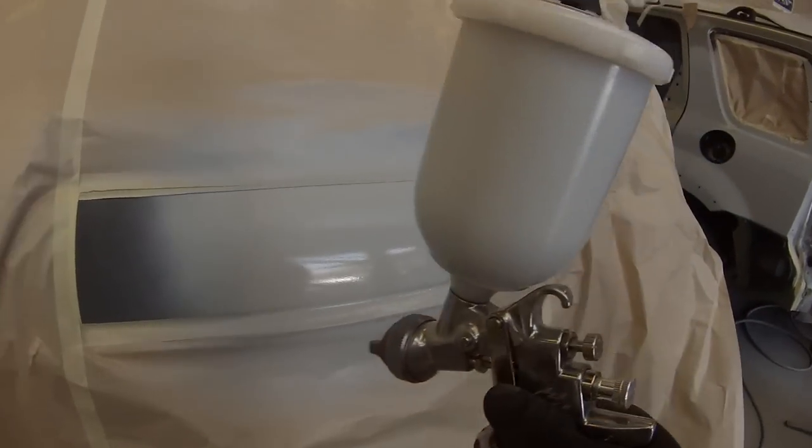I gave it another flash-off cycle of about five minutes on those heat lights, then cooled it back down by blowing air on it for a couple of minutes before putting the next coat of primer on. That's quite an important step. When I first started using heat lights I've melted tail lights, boiled primer, and blistered paint — all that kind of stuff. Everything I tell you guys I tell you for a reason, and if you own your own garage it's going to save you some money.